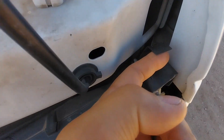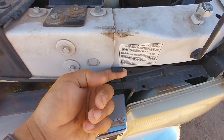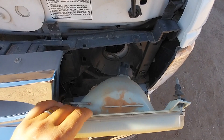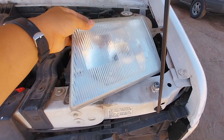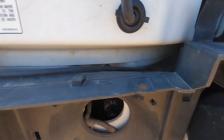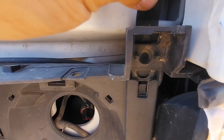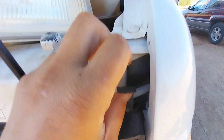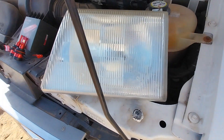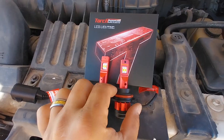You're going to have two tabs. You just literally pull them slightly forward and then pull them up — and look at that, the headlight just comes right out, I already unplugged it. I've never seen a setup like that. These clips come down, go right into the hole, and lock into a groove. That's a genius idea — I give Ford props for that, it is super simple.